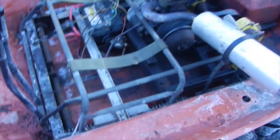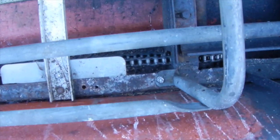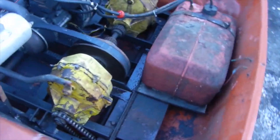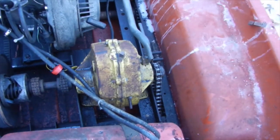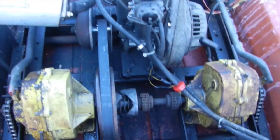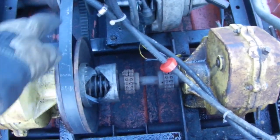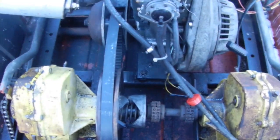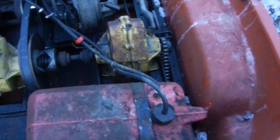Here's the underside — it's a pretty simple setup, really. It's got a subframe with all the axles going into it, everything's chain drive, fairly hefty chain. The engine sits in the middle, you've got your torque converter there, and then the two transmissions — those were also made by the Vesely Corp. I think the bands are still available, and I can still get seals and bearings if I need them. The torque converter, for the short time I drove it, seemed to work well. I'll probably need to pick up another belt and find another gas tank — it's got a boat tank in it now but the hole doesn't really line up with the hole in the body, so I'll have to rig something up for that.